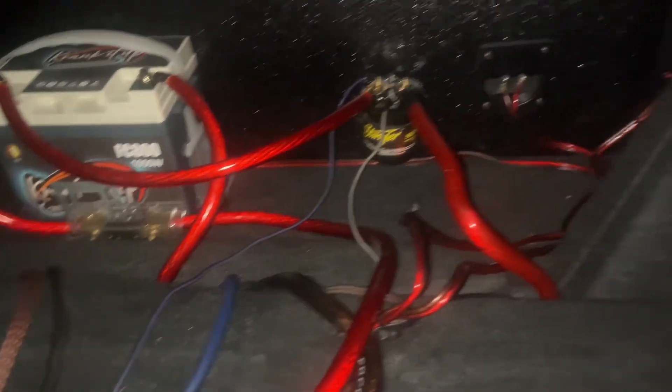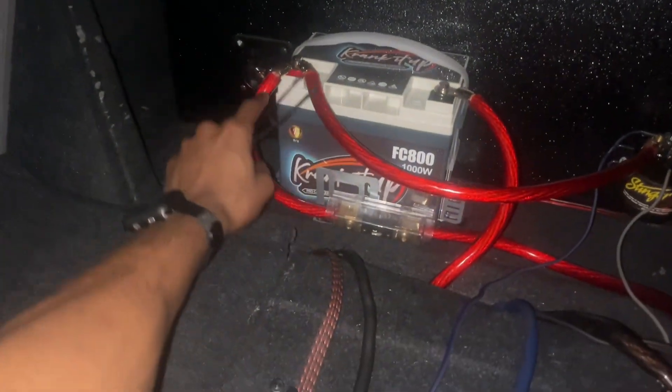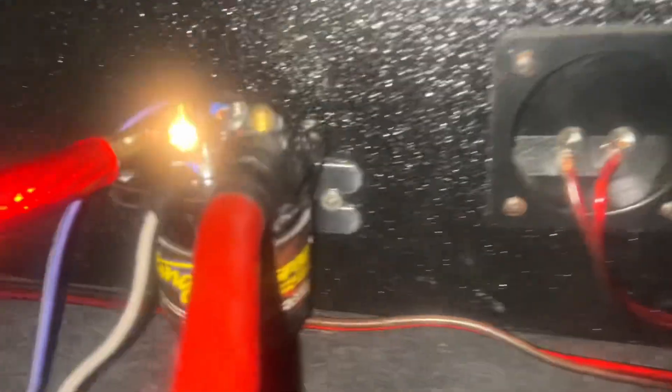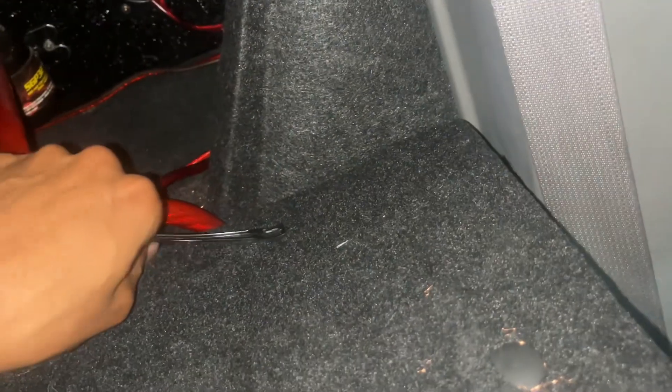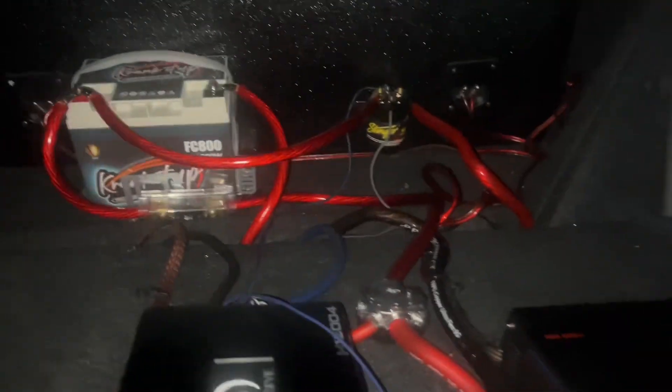Although it looks a bit ugly, I'm finished. Main wire goes to one side of the isolator, other side goes to the secondary battery positive, and then another positive with a fuse goes all the way to the amps — in my case the distribution block. Got a ground from the battery and a ground from the isolator, both going to the same chassis point. The remote wire connects to this amp's remote terminal. I got brackets to hold the battery in place, screwed onto the back of the box. I'll come back and let you know how the voltage looks.